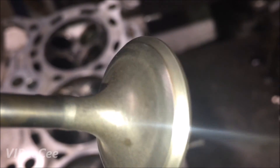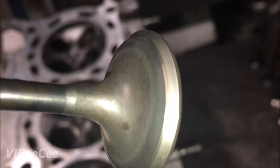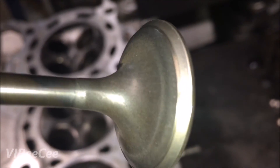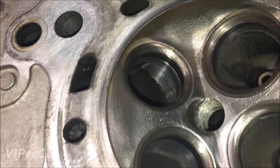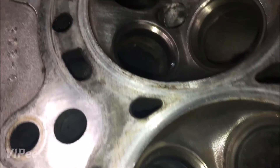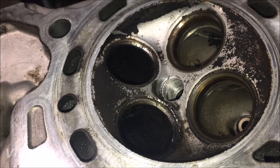You can see from the intake valve there's a good contrast — that's pretty smooth. Sure, it's got some miles on it, but intakes typically don't burn unless they're over-tightened or bent. So that's what we're looking at from that ghetto leak down — it's actually a lot worse than you would have expected. Those exhaust seats and exhaust valves are pretty well hammered.